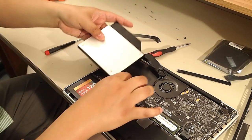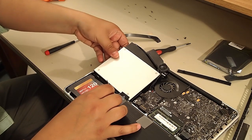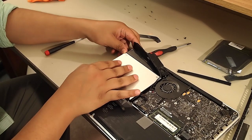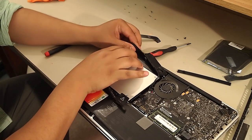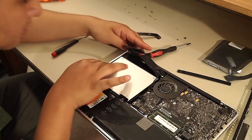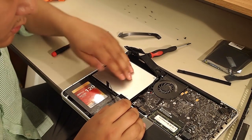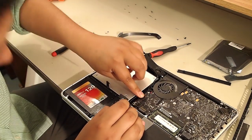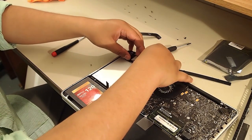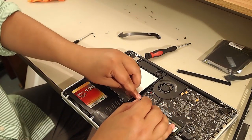I'll also put a link to the solid state hard drive — my 120 gig — it's been good, I've had it for almost a year with no problems. Now just put the caddy in snugly. Also, I forgot to mention: that connector I'm about to plug in doesn't come with the caddy — it's an adapter you pull off your old CD-ROM. The CD-ROM you removed will have it; you just unplug it from the CD-ROM and plug it into the caddy.